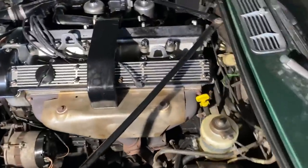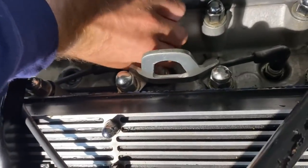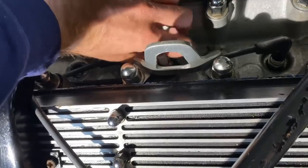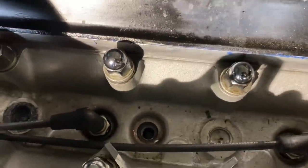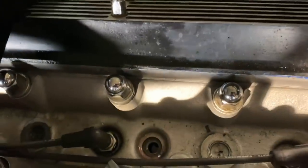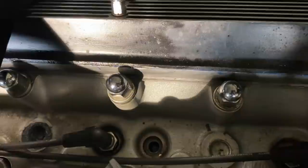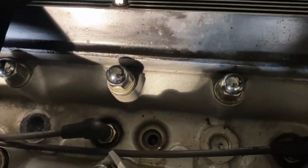It's been 48 hours now since I put the ATF down in here. It's just been sitting and yesterday I could still see a lot of fluid in there. Most likely there's still a lot of fluid left in there. I don't want to hydro lock the engine, so I'm going to put a rag over here and just spin it over with the ignition disconnected to get most of that out.